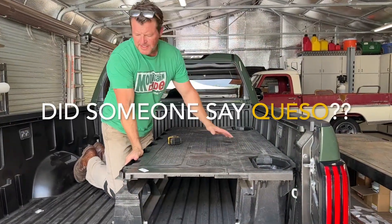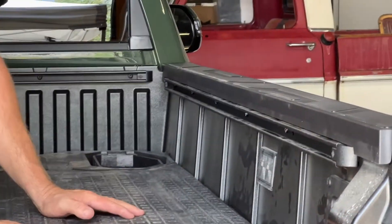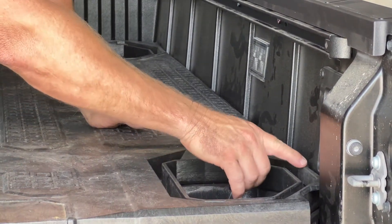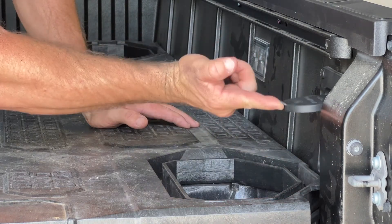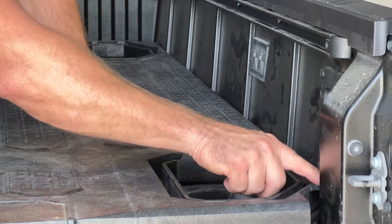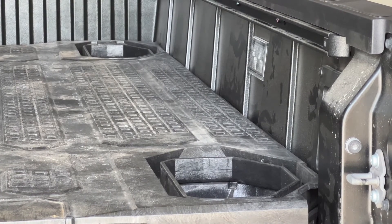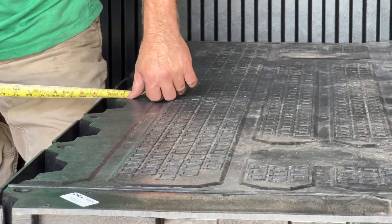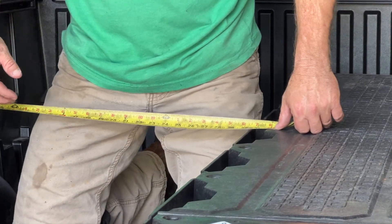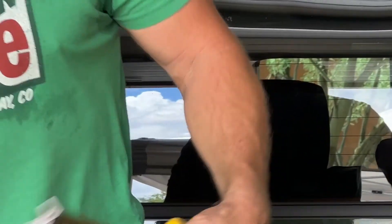The first one is now cut and put back in the truck, and you can see how tight the edge is to the sidewalls of the bed. My truck has an AC power outlet in the back whose frame protrudes a bit, so I had to cut just a little more around that. If we did it right, we can measure again and should have 31 and 3/4. Now we just do the same thing to the other side and have a full deck system.